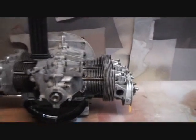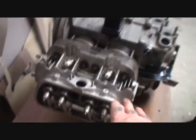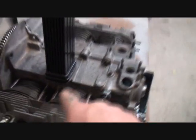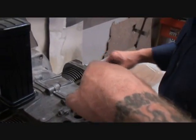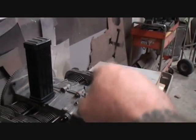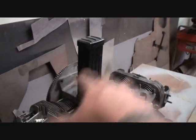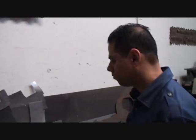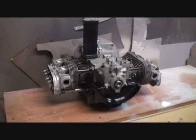So, what did William do to it? Let's see, he completely rebuilt the heads, brand new, right? And on your particular engine, one of the cylinders was different, dude. Do you remember that? So what William did is he found a 40 horse cylinder and he also did a square by balancing your pistons. All the pistons on your motor are not precisely balanced, but they're balanced enough where it's going to even run smoother than it did before. You understand what I'm saying?